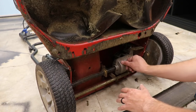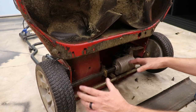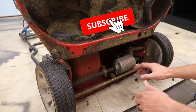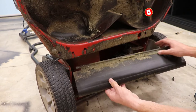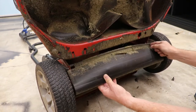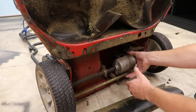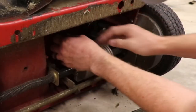It gets a little complicated. Down here is the transmission used for the self-propel whenever you're walking behind this mower — it has a pace-setter so it travels at the same speed you walk. There's a belt connected to that transmission. In order to get to it, I had to remove this little plastic shroud, which is there for safety. There are just two screws on the ends that I untightened with my fingers — pretty easy.